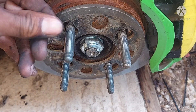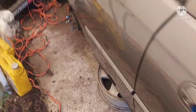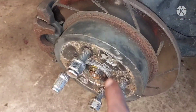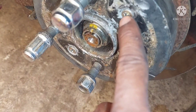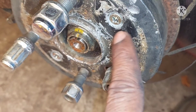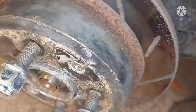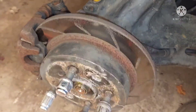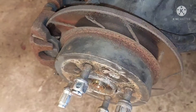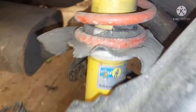When you do the rear disc brake swap, make sure you put these little bolts back in. Put some anti-seize, clean up the hole with a wire brush, and put it back in — because it makes the craziest noise when the rotor starts slapping around. It literally sounds like your car is dragging something. You can see I have the Bilstein shocks here with the Eibach springs.